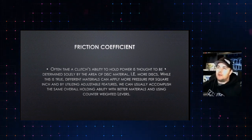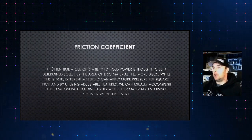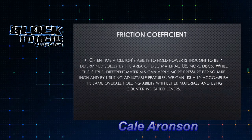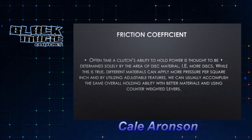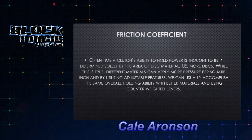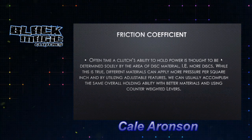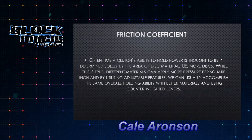So one of the most annoying things to me out there, and I'm sure if there's any of my 500-inch fellow brethren that might sign in or listen to this at some point, it's the reason why we work with a lot of the teams to do custom lever design, whether it be with the old Ace or the old East West or the Leanders, which currently most run the 6.6 Bonafani. We rework those very commonly with our clutch dyno and stuff. It's kind of funny, I saw a video that they posted a while back, and you look and you say they're putting weight on every other lever instead of every lever.